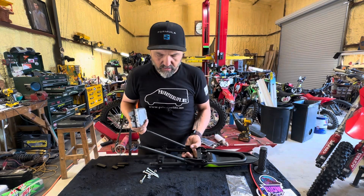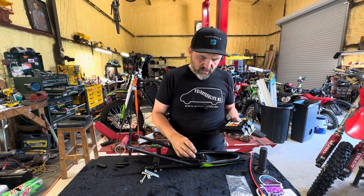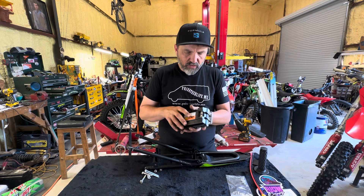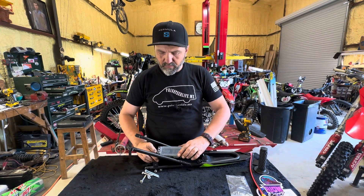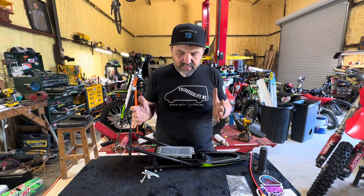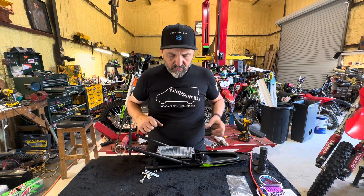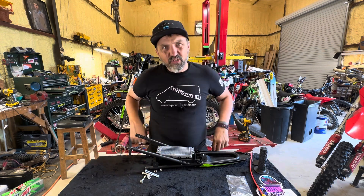What I'm going to do is use some little brackets — some standoffs. This one here is an inch and a quarter, and these are two inches. We're going to put those there so that the heat sink is out in the fresh air, and this will bolt in and sit like that. That's how I'm resolving this issue. It did not come with a bracket or any instructions saying hook this up this way or that way. Sir Ronster had some gaffer's tape on it to hold it in place, but I'm going this route and I'll show you how it looks all bolted up.